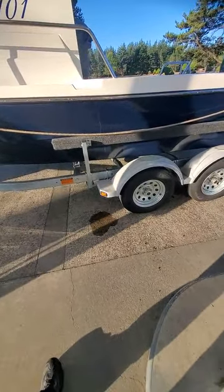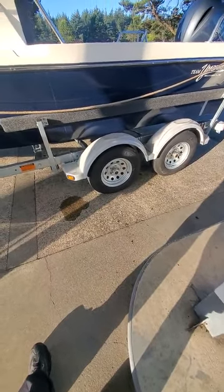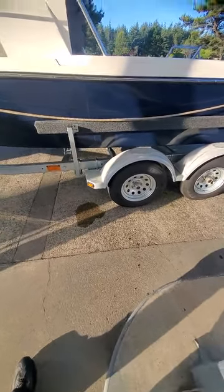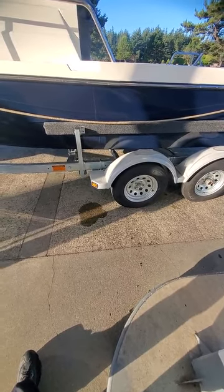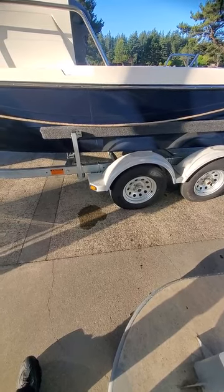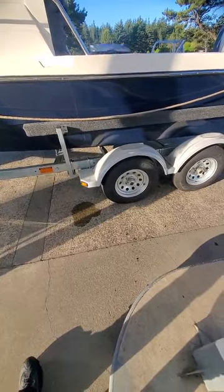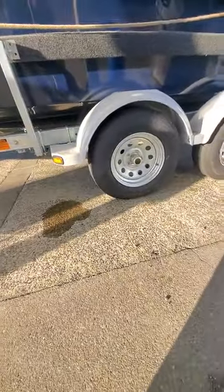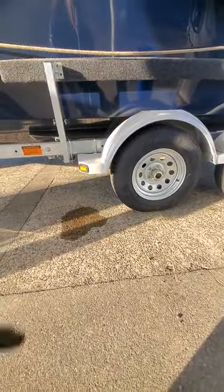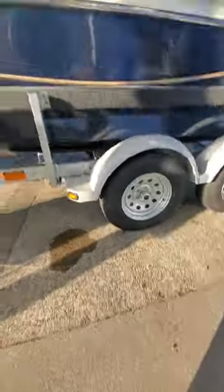About seven to eight foot. Tandem axle. Gear bath oil hubs — brown is good, white is bad. White means you probably got water in there. I always check them when I dump the boat in and park the trailer. If you travel quite a ways they could get a little frothy looking — let it sit overnight. It'll look like coffee with a lot of creamer if you've got water in there. Five lugs, 80-pound torque, 50-pound tire pressure cold. They're Carlisle tires, ST205/75R14s. Torsion axles, two-by-sixes, double-dipped galvanized — plenty of trailer for this boat.